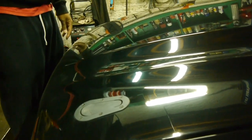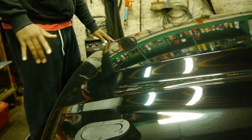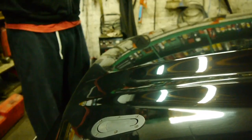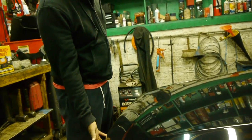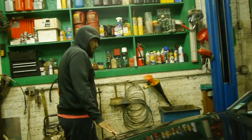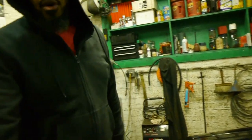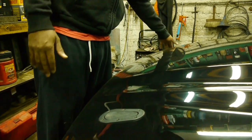We got to do an intro. What did he do to make that strut work? He didn't do anything. The strut was not the issue. It was the pins. The pins didn't allow the hood to come down enough. So you're probably using a latch, aren't you? Yeah, that's the thing. I'm not. I'm using these pins, and you see how far it pulls it down, right? Yeah. The front bumper and all that needs to be adjusted, but you see how.